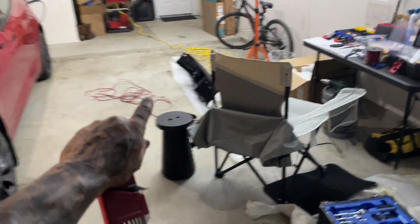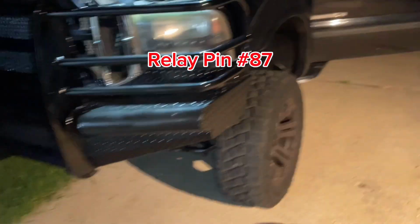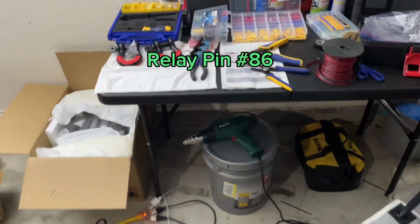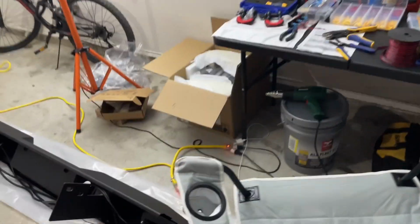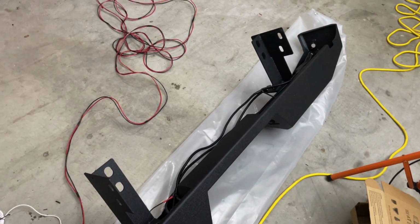Remember, just recapping, these 2 are gonna fill up the 3rd port. And then the final port, the 4th port on the relay, is gonna go to our switch. If you wanted to keep it simpler, you could just do 1 switch like we discussed in the beginning of the video. Don't want anybody to get lost in the video.